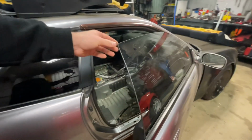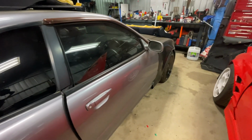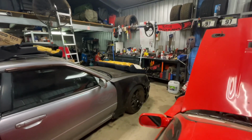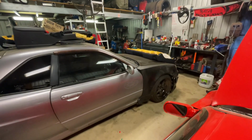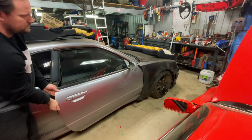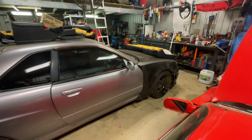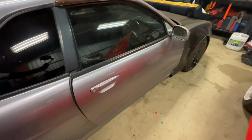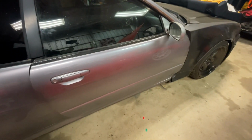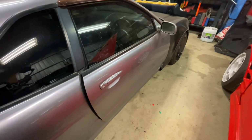And yeah, another thing's the reason why it's doing that. The door's actually sloping down towards the rear of the car a bit. The hinges are flogged out. So I'll see if I can get a good shot of that. So yeah, looks like the play is more in that upper hinge, but I'll replace both of them anyway. So yeah, there's a couple of things to note down.